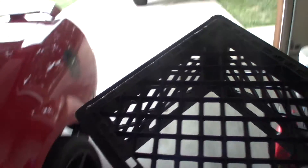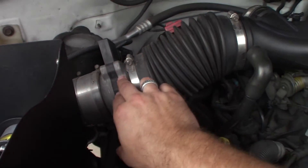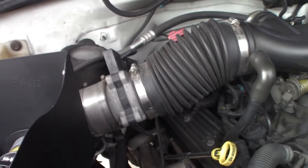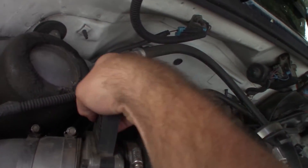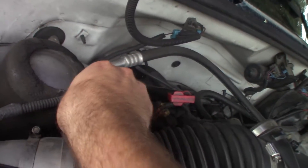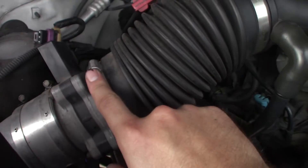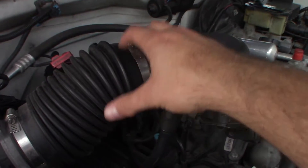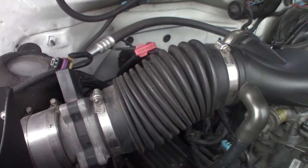Get the old handy milk crate step stool. The mass airflow sensor is this piece right here, which is typically connected to your cold air intake or just your stock intake. Removal is fairly simple — all you've got to do is unplug one of the plugs back here, then unscrew this clamp and this clamp, and it separates from your intake. I might even go as far as just taking this whole section off so I can get everything back nice and easy.